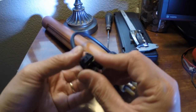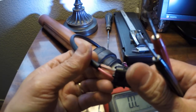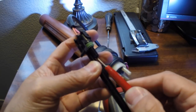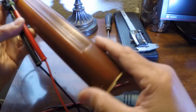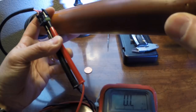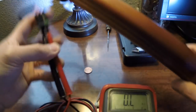Let me go ahead and start with the ohmmeter reading. The wires: pink with black is your negative — slide it in there — and solid pink is your positive. It's probably not going to give me any reading; it should have given me a reading already. The float is at the bottom, and if I slide this upside down, you'll hear the float hit the top of this fuel sending unit. No reading. Not even a reading. So I have a strong feeling it's the F1 fuse.